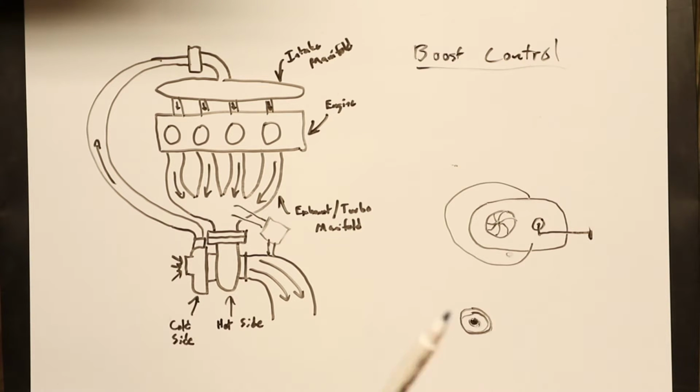This is an issue now because with this transmission in the car, I can put more load on the engine, and more load means I can build boost faster and build more boost. And along with the recent weather and it being colder out, the air is more dense, which also makes everything more efficient. So now I can run absolutely zero duty cycle on my electronic boost controller, and I'm still making over 22 pounds of boost by the time I hit redline.